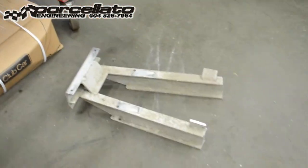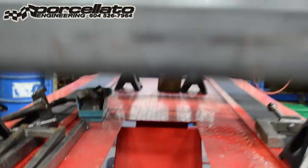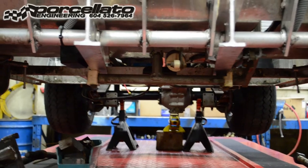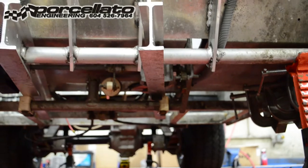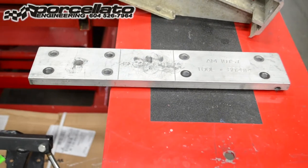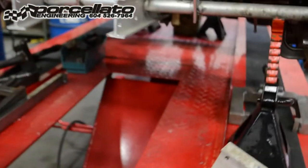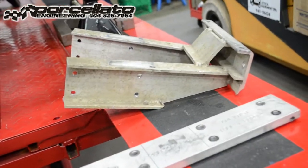As we mentioned, there's going to be some welding. We got the front frame rails — the I-beam portions — basically perfectly straight back into the chassis on both sides. Then we went ahead and cut off that mangled section and used the factory drill and cutting guide to get the holes drilled in the existing frame as well as the piece of the front end that we salvage.